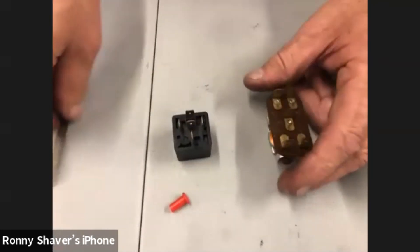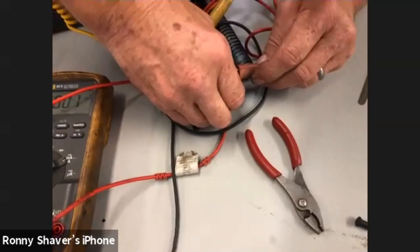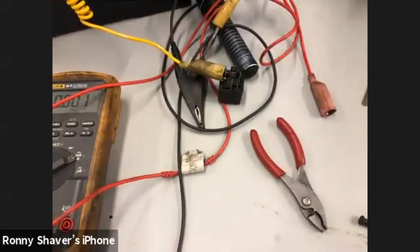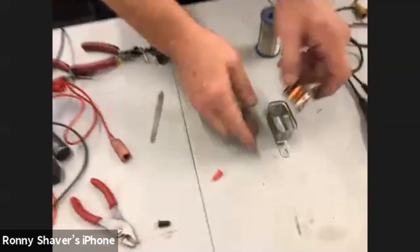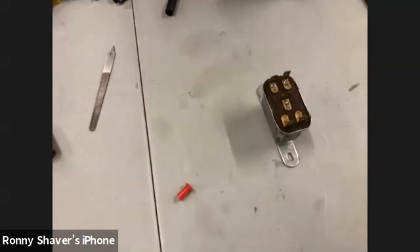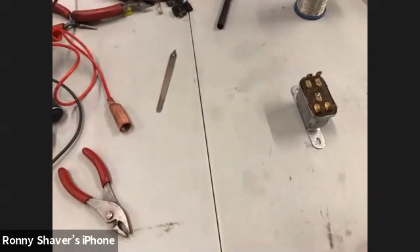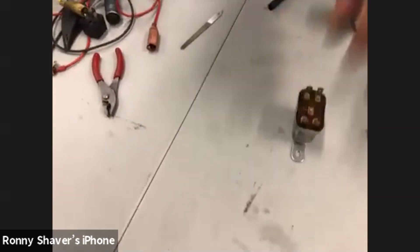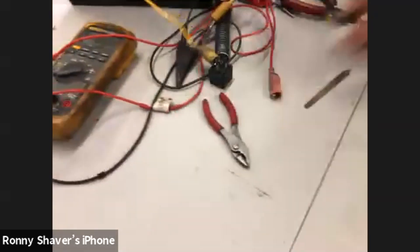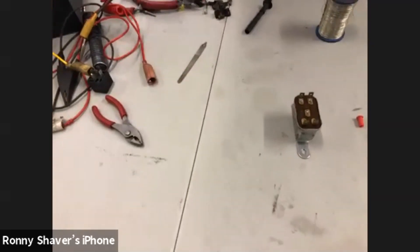And then 30 — on this relay, let's see if this one works. That relay is working. Lucas makes this basic same relay in different configurations. The new ones come with a seal so moisture can't get in. The Bosch relays are typically what most cars went to, and this relay probably costs about 70 or 80 bucks, while this one costs about 10. So there's a motivation right there to upgrade.